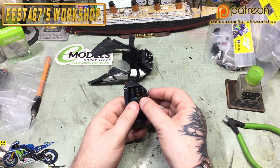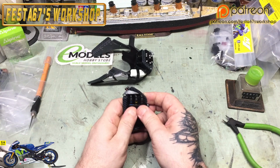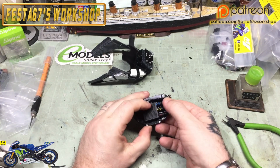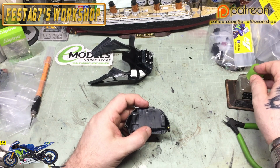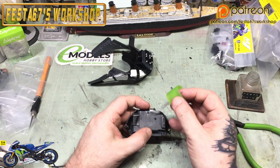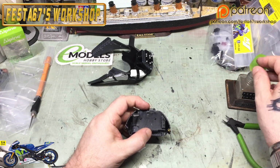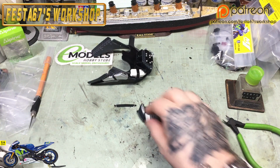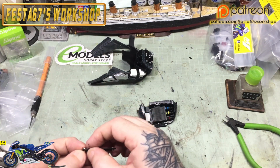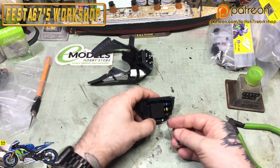The ECU then will just drop straight in like so, and it's a press fit, but I shall turn it upside down and just drop a bit of extra thin in the pinholes there like that. One in there, just to let that bite. And then the strap itself just drops in the little slots that are cut in there. Like that.